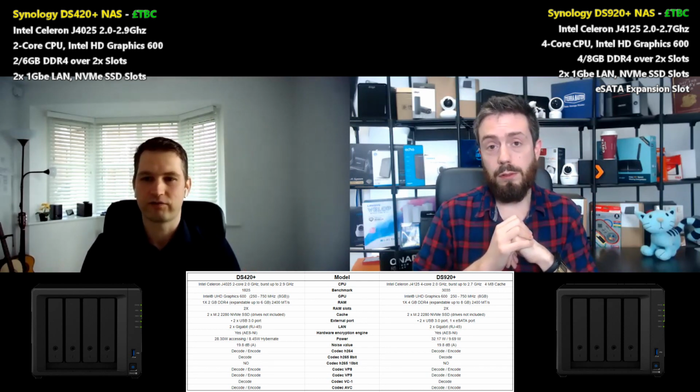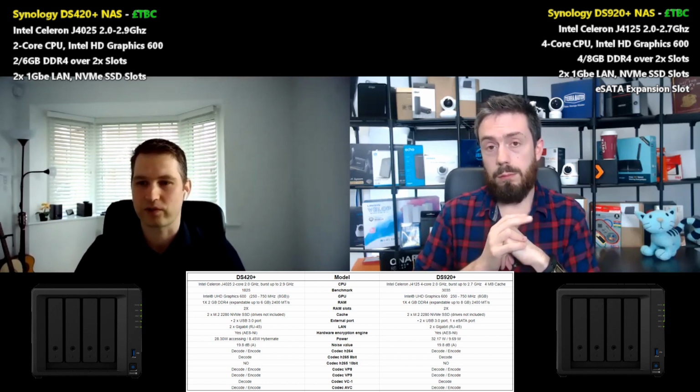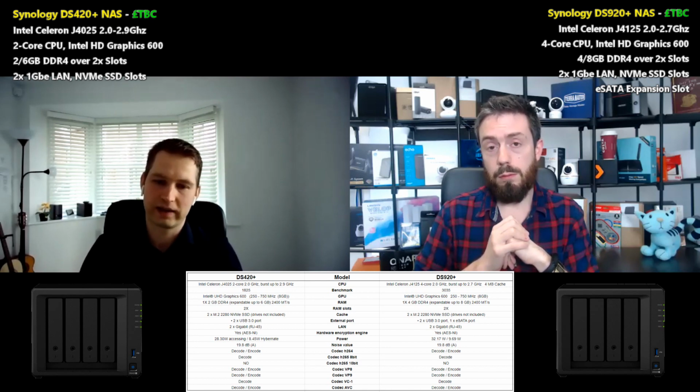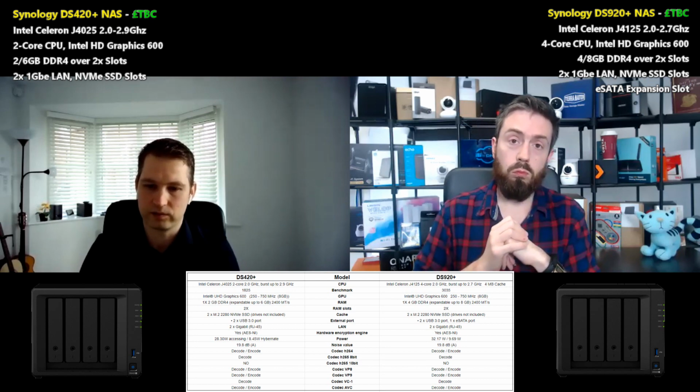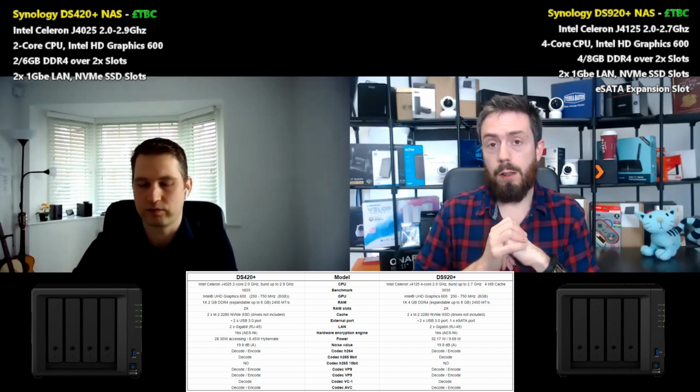So people buy this 4 bay and stick 2 or 3 drives in there. So you get this RAID 5 on 3 drives, which means you maximize your available storage space on your NAS. Because when you buy a 2 bay, you've got just these 2 bays mirroring each other, and you effectively lose 1 drive because of that. But if you put 3 drives in there, you lose only 1 drive for redundancy, for all the safety features. I agree.